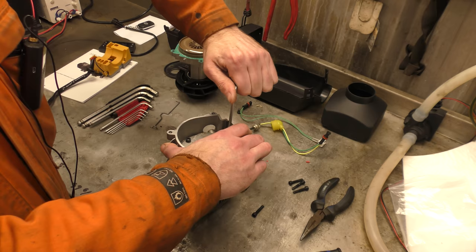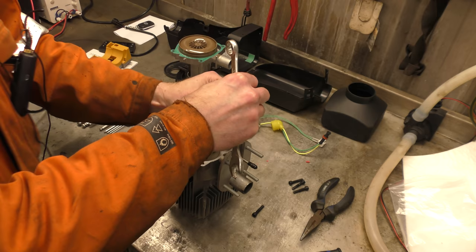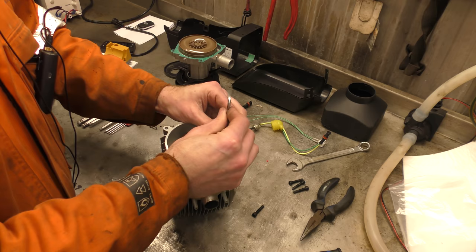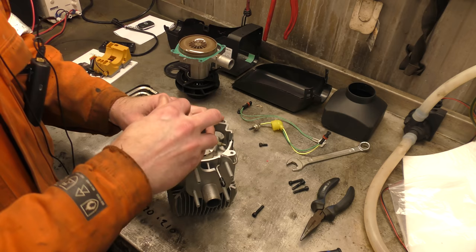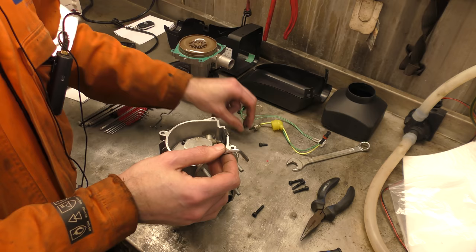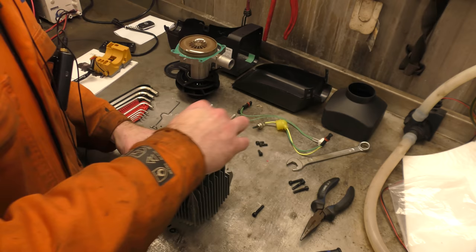These bolts are quite tight — not stupendously tight, but just tight enough. She's been run — she's sooty, so this diesel heater has run and been tested, which is nice. I'm not going to lie, I don't see anything obviously different between this pro burn chamber and the normal one. That base plate feels awfully thick, but surely that can't be the only difference. It's your aluminium housing inside. There is a metalised foil gasket with gasket material on the other side — feels weird. Exhaust hole feels all right — it's not got any horrendous burrs or bits not machined off properly. Now for the sizes — there are two kilowatt and five kilowatt heaters. The heater body sizes are completely different, the burner sizes are different. There is no 8 kilowatt, no 10 kilowatt, no 12 kilowatt. These are just numbers printed on the outside of the box — you want more heat, you put more fuel in. That's how you're getting those weird numbers.